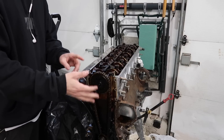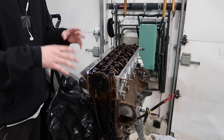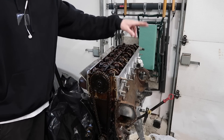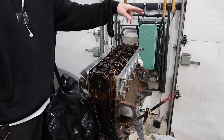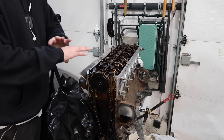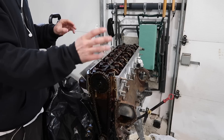The nice thing about the 635 is that the accessories that come in it will all fit right in the E28 — power steering pump, alternator. You could probably mix and match a lot of this stuff, but you will know for sure that the power steering pump will line up to those lines. This is a 528E, so it's got the traditional brake booster instead of the hydro boost — hydro boost could be totally different. But alternator will all line up.